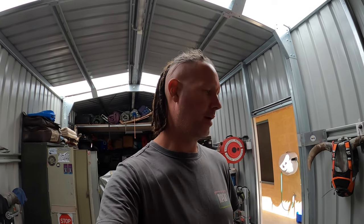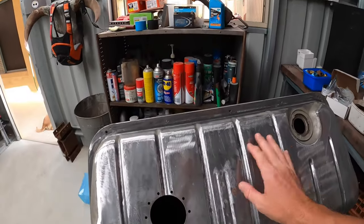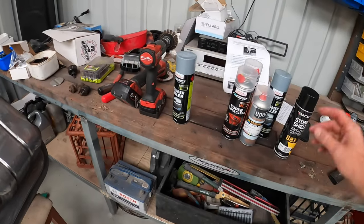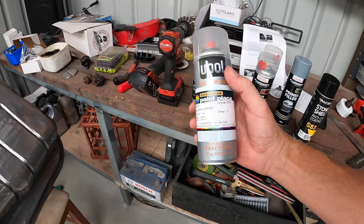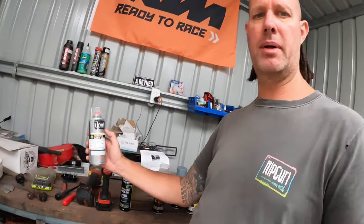I'm not going to worry about painting it with the gun because I haven't used it before and I don't know what sort of finish I'll get. I've got a high fill primer — primer filler — three coats of that, top and bottom, then sand by hand with 600 grit. On the top I've got some custom paint made up — warm silver metallic, with just a little hint of gold in it, so I'm thinking that might go well with the body of the car.